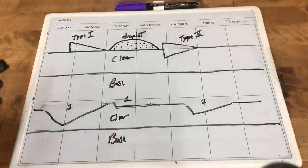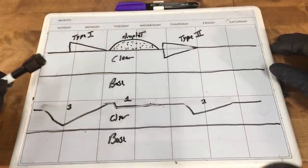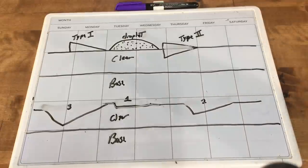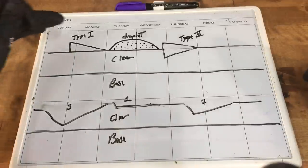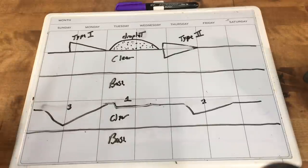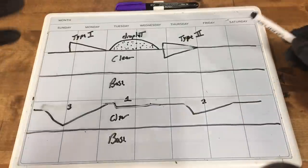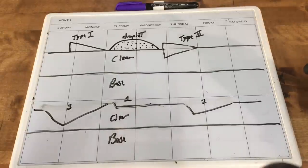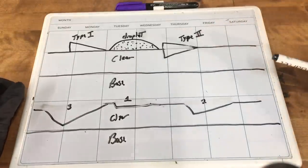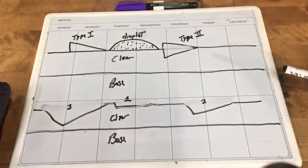On the whiteboard here we have clear coat and base coat. Here's a water droplet with some fallout. When the droplet dries up and leaves the deposit, it can leave a Type 1 or Type 2 water spot. Type 1 is when the calcium scaling or fallout is left on top of the clear — that can be removed chemically. Type 2 is when you remove the scaling chemically and there's etching from water leaning towards the acidic portion of the pH scale, which can etch deep into the clear.